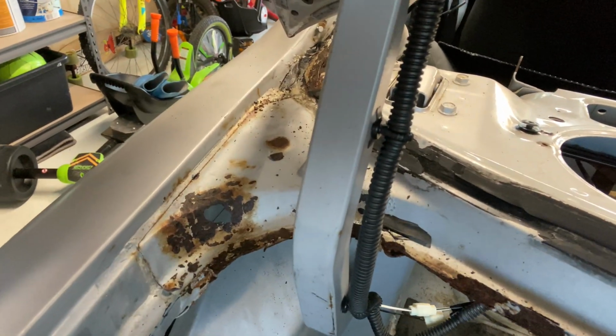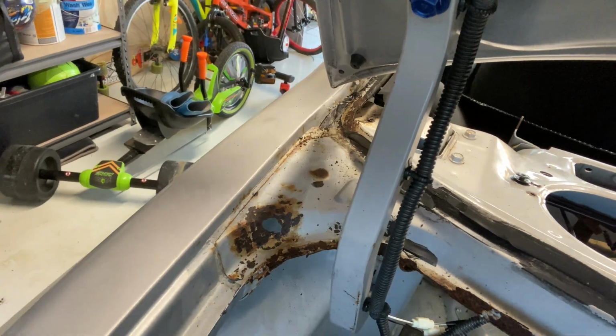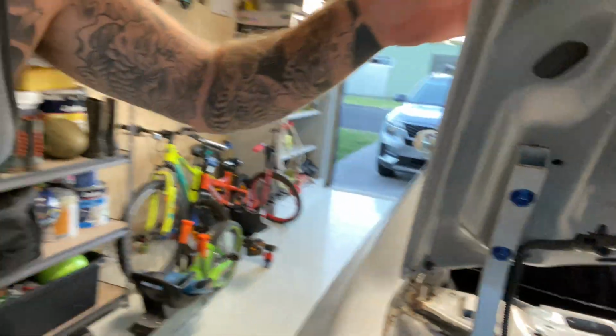There's a few things. It's got some rust in the rear parcel tray sort of boot area. Actually, I should be able to show you that. So if we take a look just down here, that piece there, as you can tell by this little join here, is actually a complete piece of that parcel tray. You can still buy them new, but I have spoken with a repair certifier and a local panel beater, and they don't think that it's necessary to replace it with a new one. So just going through the motions now to schedule a time that's suitable to get that work carried out.